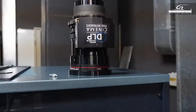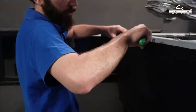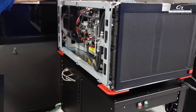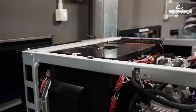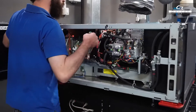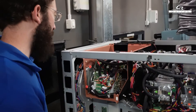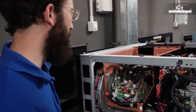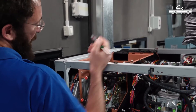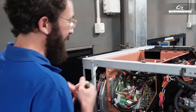Removal of the lens. This is the lens that will then be reassembled onto the new motor. Removal of the cover — I am simply removing the partitions to access the sealed compartment where the engine is located. A couple of barriers, and then the compartment is sealed because it needs to let in as little dust as possible. This is the part that we need to change. It is a 4K chip with a diagonal of 0.98 inches, while the old 4K chips were wider at 1.38 inches. So they managed to fit more pixels into a smaller size.